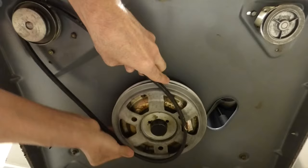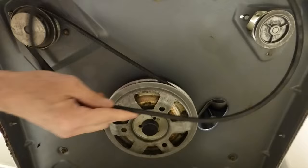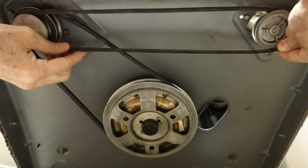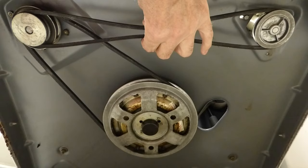Push the motor in a little bit so we can get it on there, but you can see the motor still moves. With the drive belt on, we'll go ahead and put the pump belt on now. It goes on the outer pulley on the motor and then over to the pump. We'll check the adjustment — we're supposed to have a quarter inch where it starts moving. And we're actually looking pretty good there. You can see it just barely starts moving.